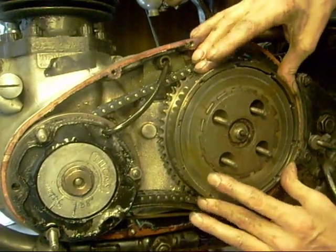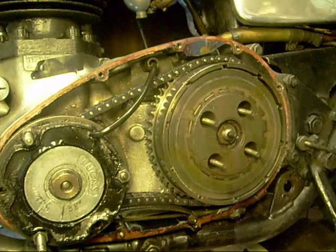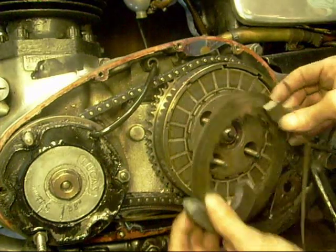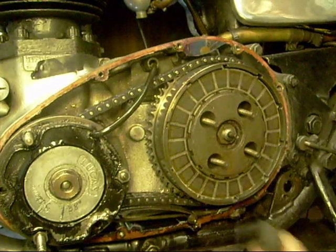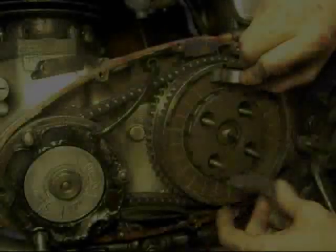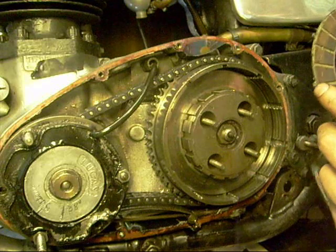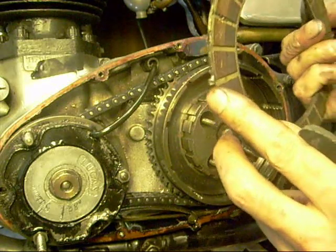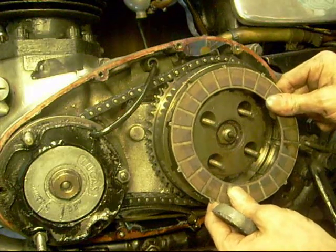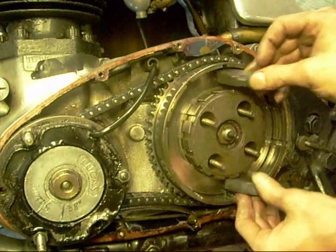Right, I'm just going to whip the plates out. You can make little hooky things to get them in, or sometimes you can use a magnet — depends which will work. I might get one or two out with a magnet. These little tangs are damaged — they should actually fit in there. Look at that difference — that makes a clunk when you're getting it in the gate and can cause problems.